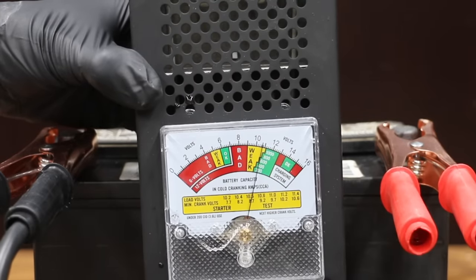Battery 5 is an AutoCraft battery that's only four years old. It's fresh off the charger at 13.1 volts. Unfortunately, it's at a very low 62 cranking amps and should be at 1,000. The battery analyzer says the battery definitely needs to be replaced. The state of health is the worst yet at only 6%, and the internal resistance is the worst yet at 62.5. On the battery load test, the needle went right past weak and landed on the red, so this battery is definitely no good. I used a hydrometer on all the cells and they all tested well except for cell 5, which is providing a very low number.